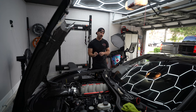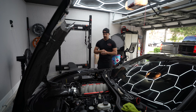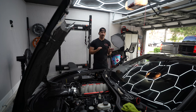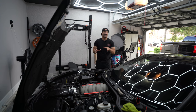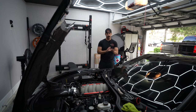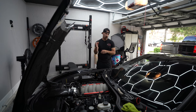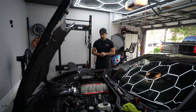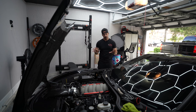I found some standing water on my cylinder head on the passenger side. I proceed to pull the plug from there and check it — the plug has a little bit of standing water on the threads. Obviously we're very, very close to suspecting a cylinder head gasket failure, but I just put this car back together — not myself, a shop — and it's got cometic head gaskets, which are the multi-layer gaskets, so they're very, very good. So I'm like, what the hell is the potential issue here?